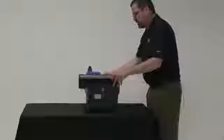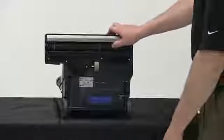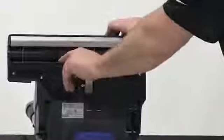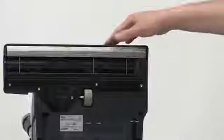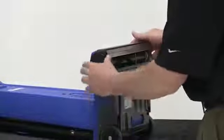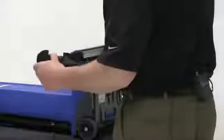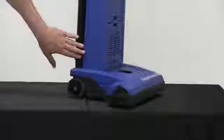We utilize a chevron style brush for cleaning. The nice thing about a chevron brush is that it's bringing all the debris from the left and the right to the point of intake. If you notice how I turn this, everything is flowing to this point of intake. Okay? Now brush maintenance is very important, so we make it very easy for you to remove the brush, and you do that just a click, and it pulls right out. Gives you the opportunity to clean off any kind of obstruction that you may have. Put it back into place, slides in, and locks.